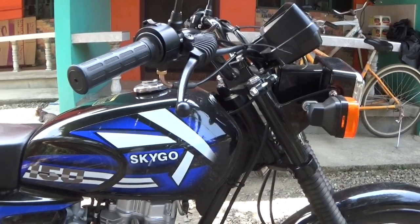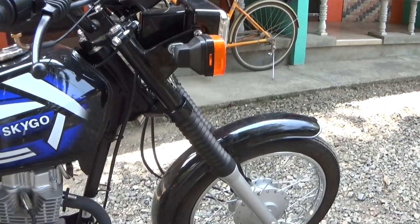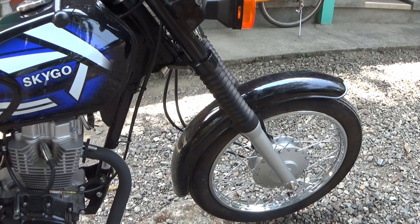Drum brakes will never be as crisp as disc, but they shouldn't be that soggy either. What usually causes that is a set of brake shoes that are contacting at one high point, and then as additional pressure is applied, the internal mechanism is shifting, bending, warping, whatever, to bring more brake lining into contact. This is a very bad thing. So I'm going to pop the front wheel off in order to take a look at that.